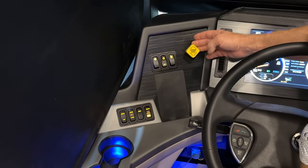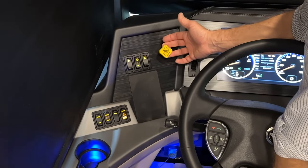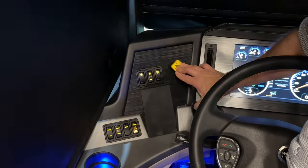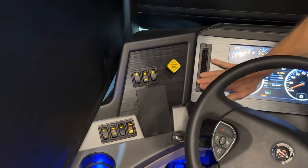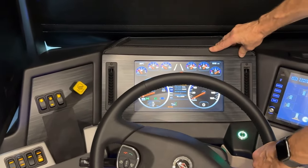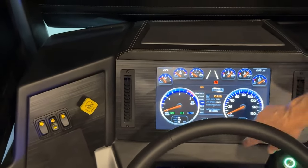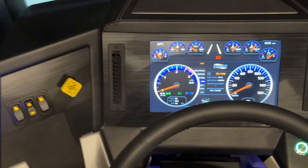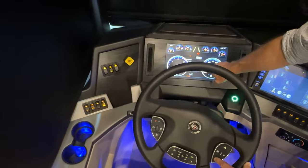The parking brake applies the air brakes for the chassis — pull to engage, push forward to travel. To the right are air louvers. Now looking at the glass dash in more detail: the center home screen lets you scroll up and down through selections using the arrow controls on the right side of the steering wheel.